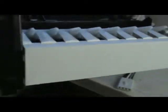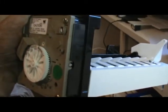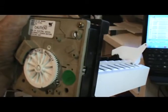These heaters will start leaking — the mold leaks into the heater and it'll short the heater out, and you can't replace that. So that's the modular ice maker. If you see an ice maker like this, you don't have to guess — that's a modular. If it has that head on it, that's the modular ice maker, that's the Whirlpool modular. That modular ice maker goes with the new harness. And if you've got the connector here on the side, that's a modular too — you don't even have to look at the head. It's got that plug — that's a modular ice maker, and that's the one you need if you have a five pin connector in your freezer.